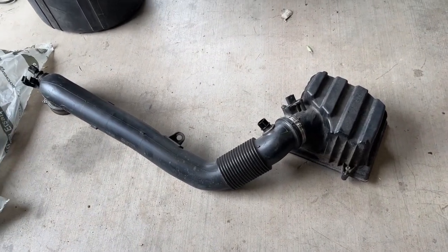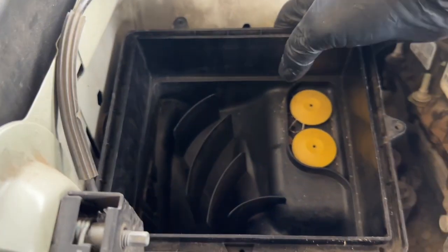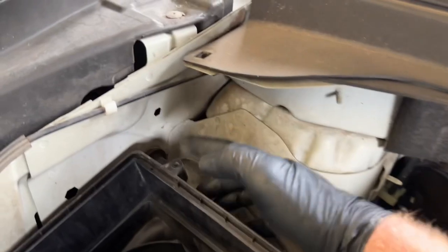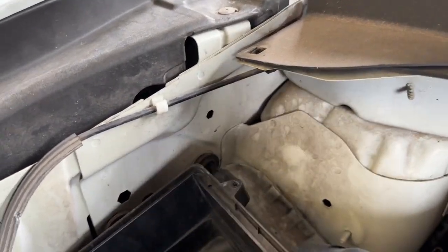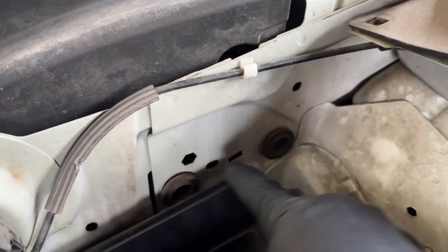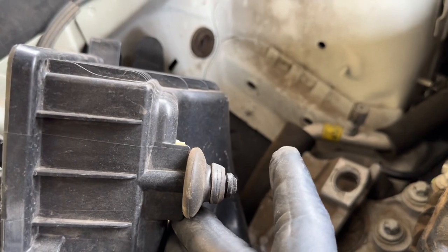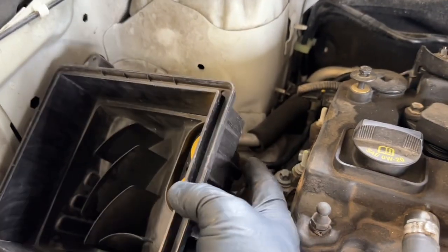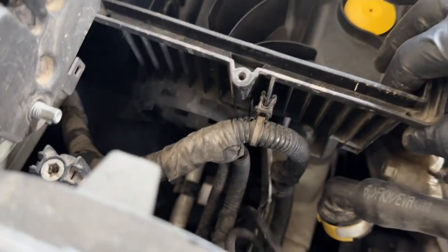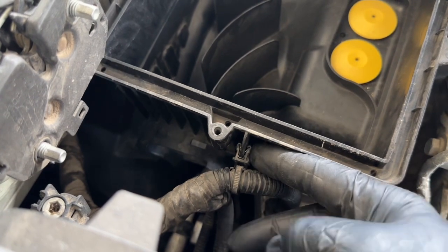There is your cold air intake. Next, take the air intake box and pull it straight up — it pops out. Pop it out on one side and pull out from the back. There are two points in the back and two grommets, plus one in the front — three points total to pull. Pull up the front first, then pull straight back. There's one other connection point: stick a screwdriver down between it and it'll pop right off.